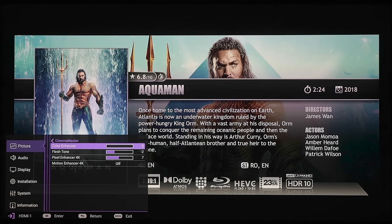Under Cinemaster we've got color enhancer which you can slide from 0 up to a plus 18. You should be able to see how bright and vibrant the image gets in the background as I'm turning that up and down. Under flesh tone we've got negative 5 up to a plus 5, which is going to give some extra warmth to the image. Under pixel enhancer we've got 0 up to a plus 15. As you can see going back down to 0 how soft and natural the image looks, but the higher you go the more overly sharpened the picture gets. Personally I would keep it at zero to keep everything nice and smooth.